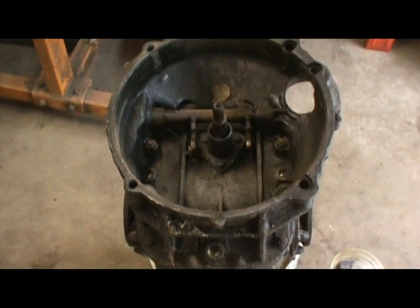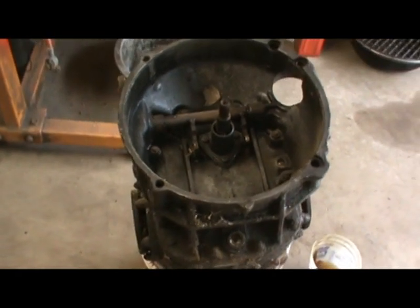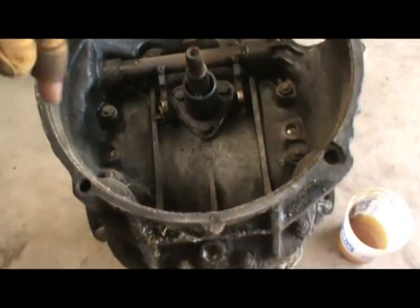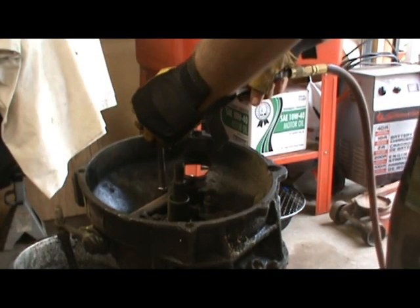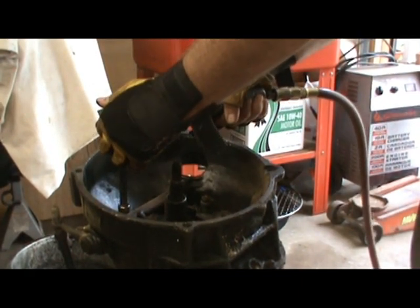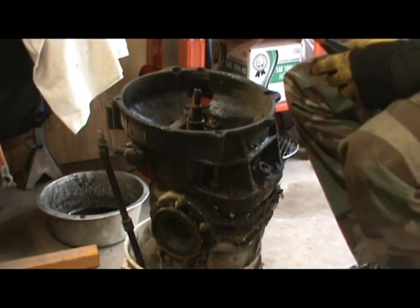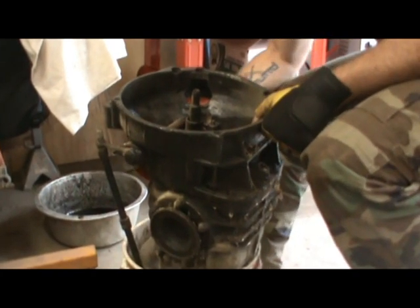I had me a big surprise. I'm starting off by taking this one off first — the one that I need. It's filthy. I want to get this thing off and give it a diesel fuel bath. It's just too nasty — I wouldn't put that on my worst enemy's transmission. We'll get that off there by removing all these bolts. There's four down here. I've got a cup of diesel fuel to throw all these nuts in. Now I want to get my bell housing separated from the transmission. It doesn't take a whole lot.